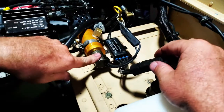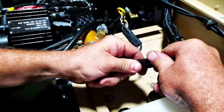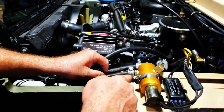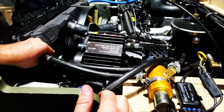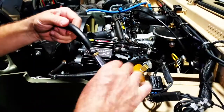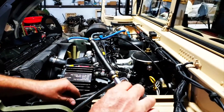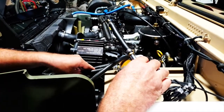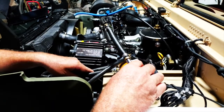If when you unplugged your Cadillac valve from the engine harness your fan clutch failed to engage, you want to unhook the hose on the forward-facing fitting on the Cadillac valve — the hose that goes up to the fan shroud. Connect an air blower with a hose clamp to it and apply 90 pounds of pressure. If your fan clutch fails to engage with that 90 pounds of pressure, your clutch is bad and should be replaced.